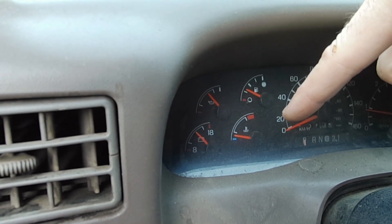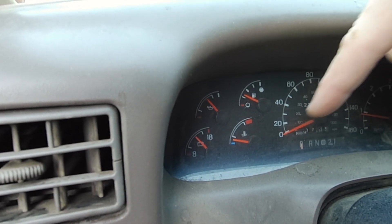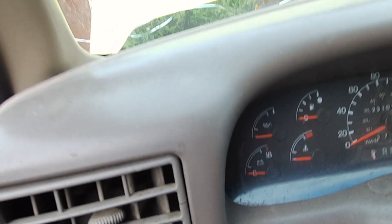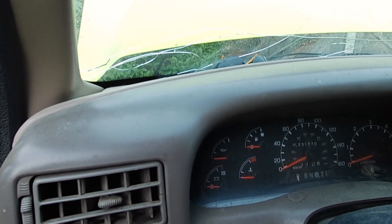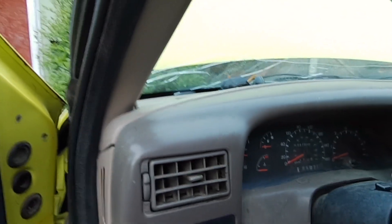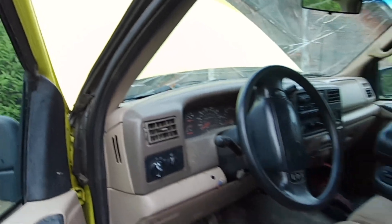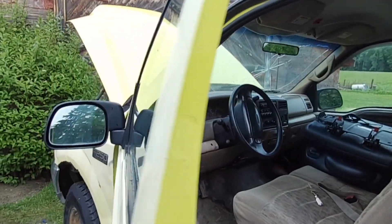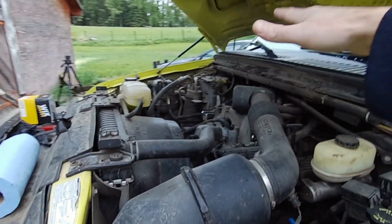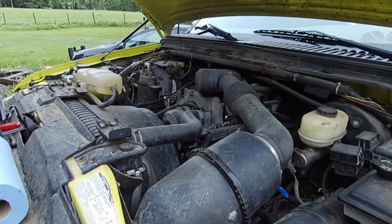You can see the temperature is starting to come up — that's probably good enough. So we're going to shut it down now, and we're just going to wait a few minutes for the oil to drain back down to the base. We can pull the drain plug in the meantime and let it start draining, but just make sure you give it a minute for all that oil to return to the base after you ran it.